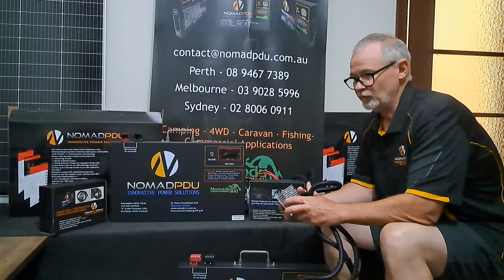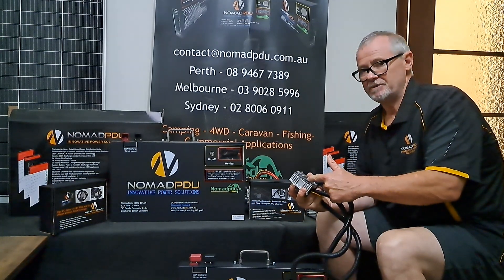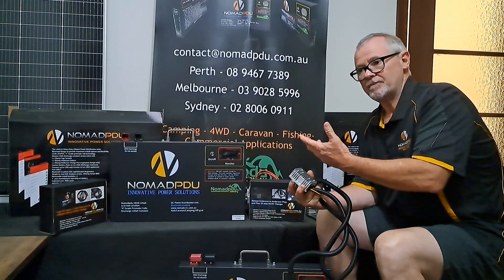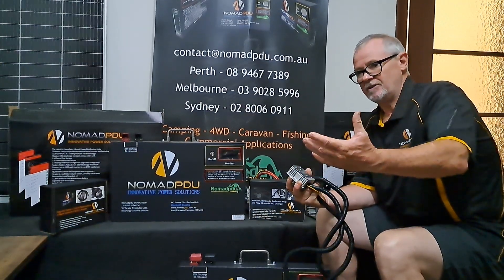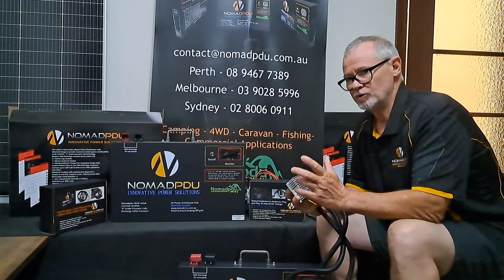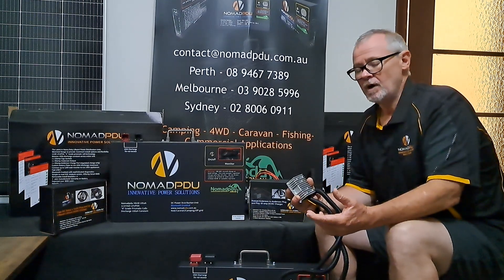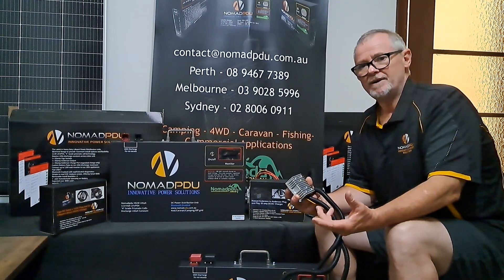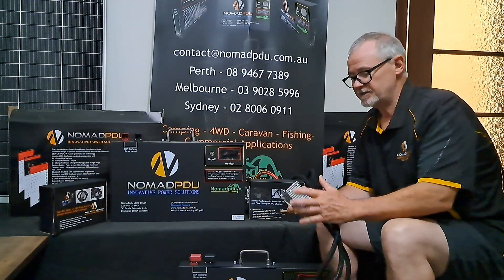What that will do is draw from the vehicle probably seven and a half amps — remember, it's converting to a higher and stable voltage and amperage, so it can draw around six or seven amps from the vehicle. Your CIGA socket is only rated to 10 amps typically, unless you've got a vehicle with a 15 or 20 amp rated CIGA socket.